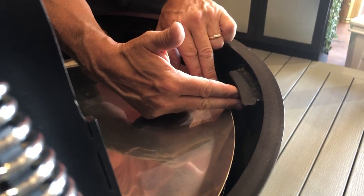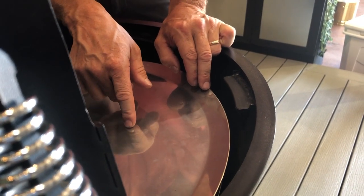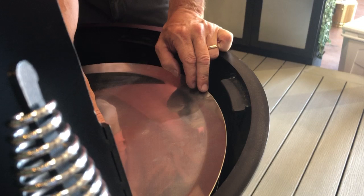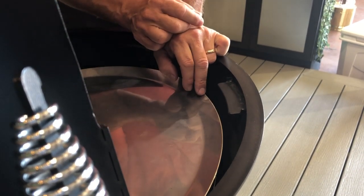If this drip pan is too low, or you can get 3 fingers or more in the gap, that's going to start causing back pressure underneath, forcing that air backwards into your hopper, and you're getting condensation, and that will cause burn issues. So again, 2 fingers or less for a gap here, and you should be fine.